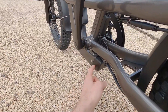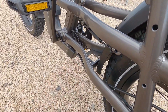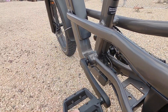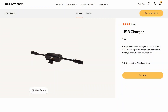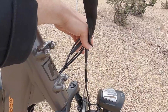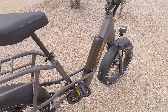At the bottom bracket, the controller box is now much more clean-looking — no more protective shield hanging down. There's a single-side kickstand with a mounting point for a double-leg kickstand if desired. There's a 12-magnet sealed high-resolution cadence sensor on the left that activates pedal assist. Up front and rear there are expansion ports for USB dongles — you can daisy chain two on each end, giving you four total USB ports tapping into that 672 watt-hour battery to power lights, a boom box, or other accessories.